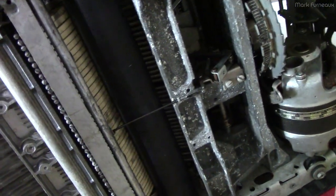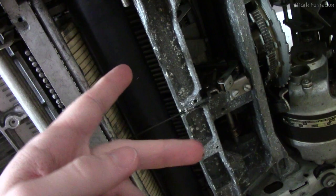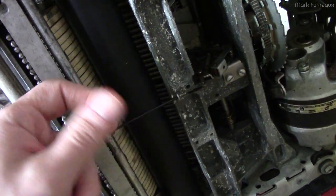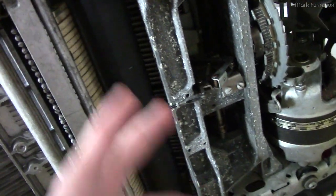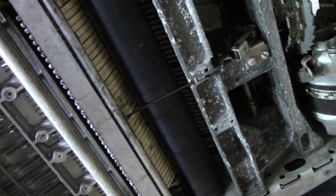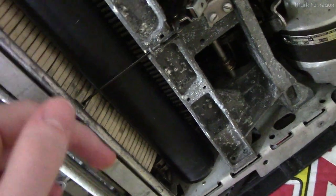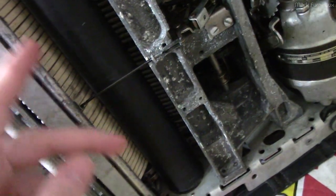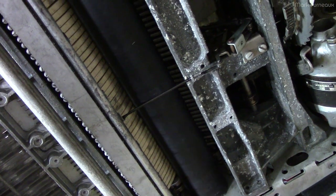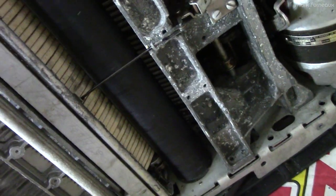The main reason the keys aren't working is that these plastic cams are slipping on the rubber roller. The rubber roller is super old and not as sticky as it used to be, so I might need some rubber roller restorer — a spray that makes rubber a little tacky. Also, I can clean the cams with 99.9% isopropyl alcohol to get the contaminants off. There's a bit of lubricant from lubricating the components above that has dripped down, so I'm going to make sure these are nice and dry and totally clean, along with the roller, and see if that makes a difference.